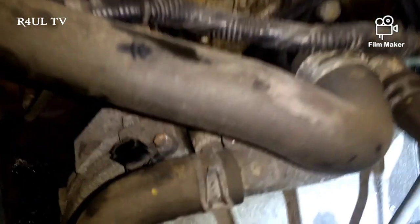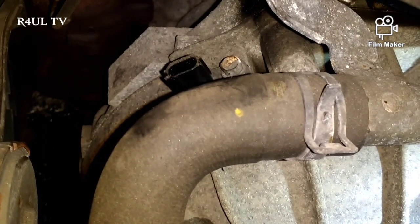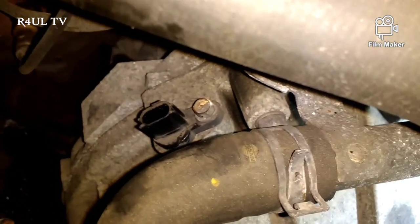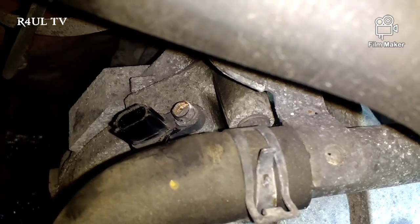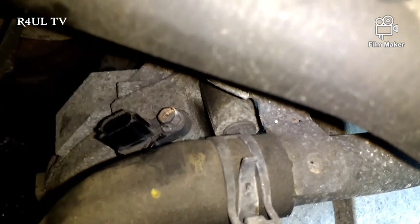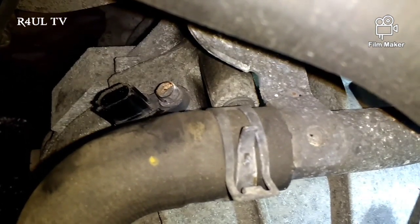The linkage cables are totally out of the way, cable tied up there. I've took the hydraulic pipe off - the one that goes onto the concentric slave cylinder. Now before we do anything else, you can see the crank sensor wire there. At least take the wire off the sensor - if you leave it on and then come to dragging the gearbox out, you're going to snap the wire and break the sensor, and then you'll need a new sensor. So just do that first. Take it off with a 10mm bolt, take the whole sensor off.